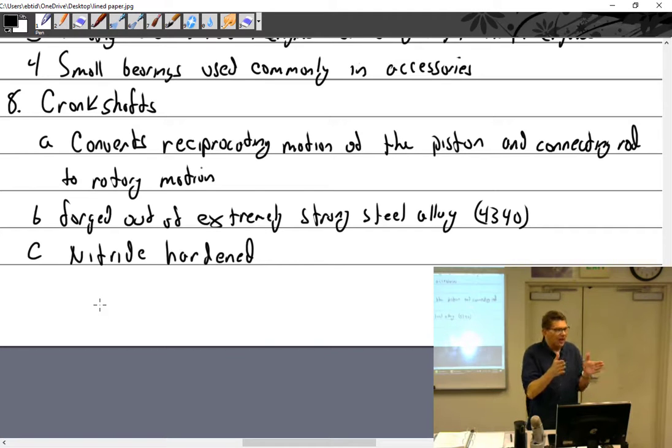It can go to serviceable, and you'd say it's now 'new three-under.' You get bearings that are a little fatter to take up that space — you could polish it to three-under, then send it out to have it ground another three, but they had to re-nitride it. The bearing would say M03, then M06, then M010 for ten thousandths under from original size.